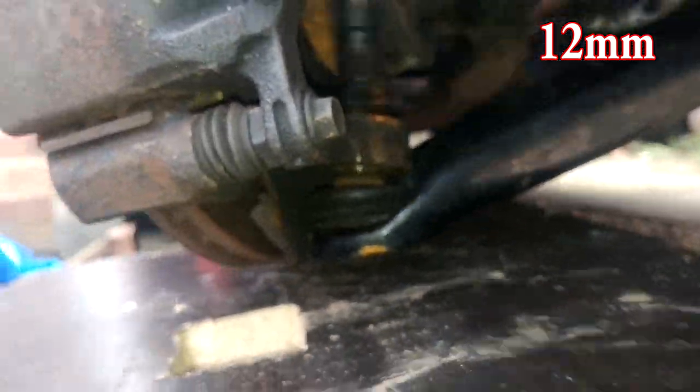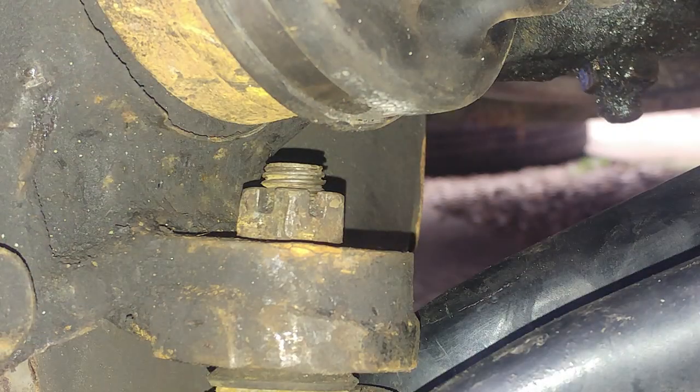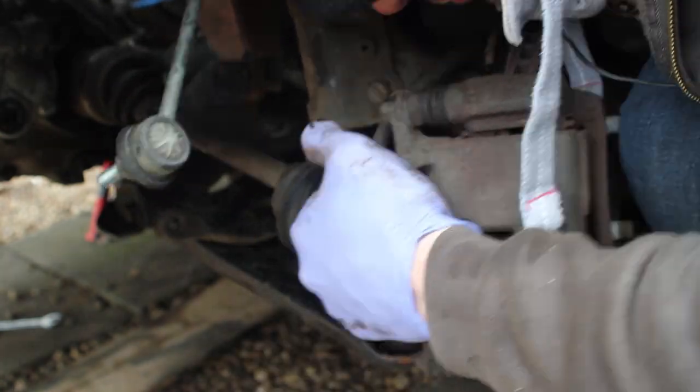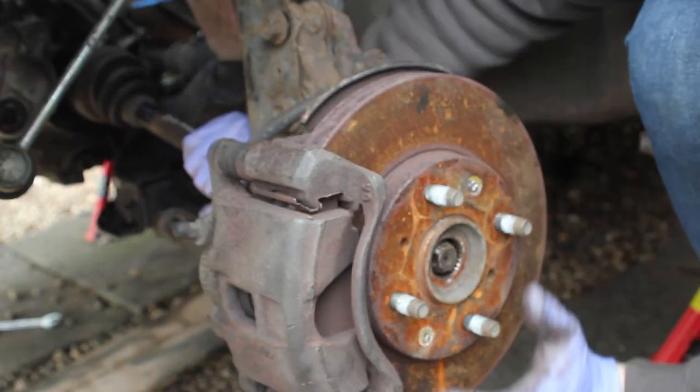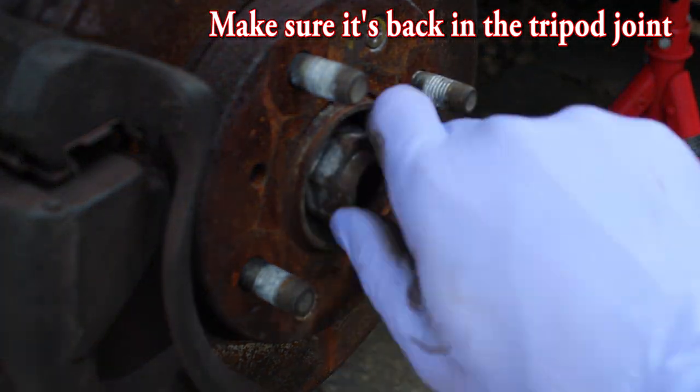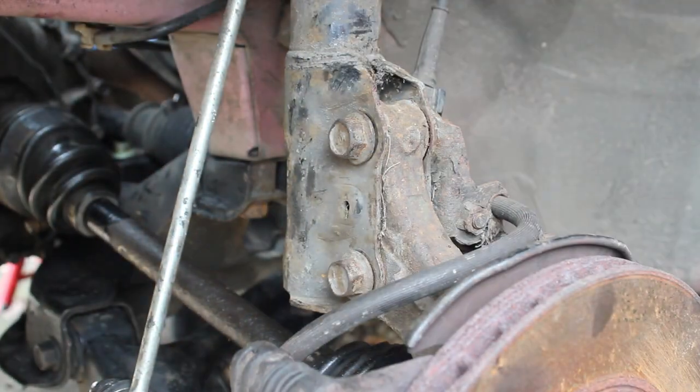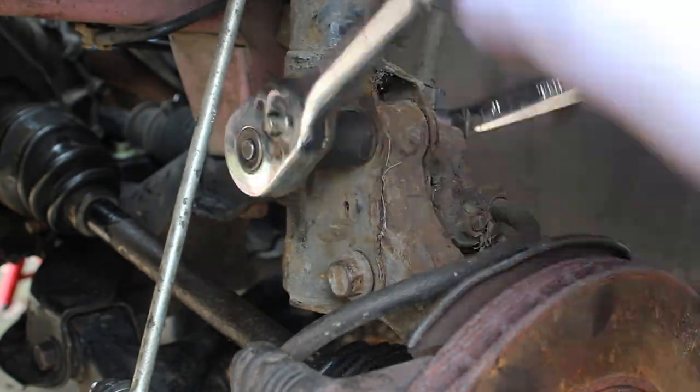We need to put the little ball joint back into place - these just push out, under and in. Then you put the nut back on top and then you need to put a split pin in as well. The split pins you take out might have been okay, but it's five pounds for a box of brand new split pins and it's worth getting. Make sure you rotate the nut to a position where you can get the split pin in easily. You can notice we didn't have to take the hub off because the lower ball joint is out, so we didn't need to remove it from the strut. We put this driveshaft back in. Don't worry about the rust on the discs - this cleaned off really quickly after the first couple of uses. We need to go around to both sides and tighten up both the struts to the hub.